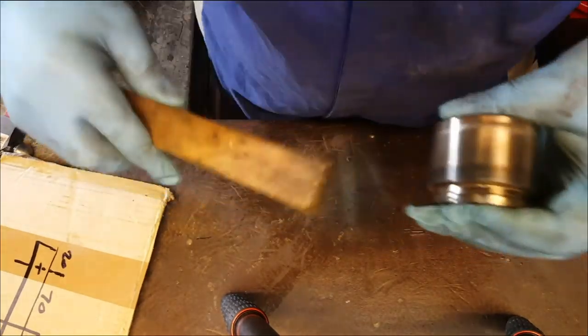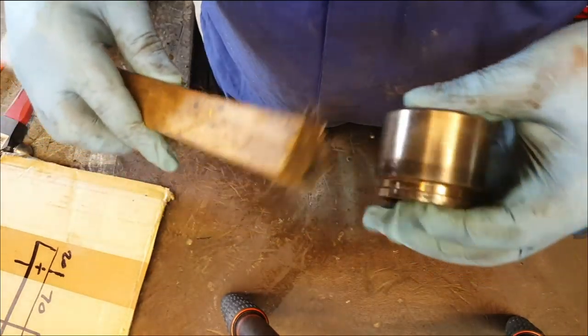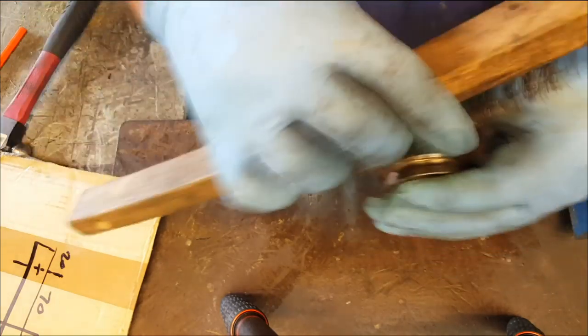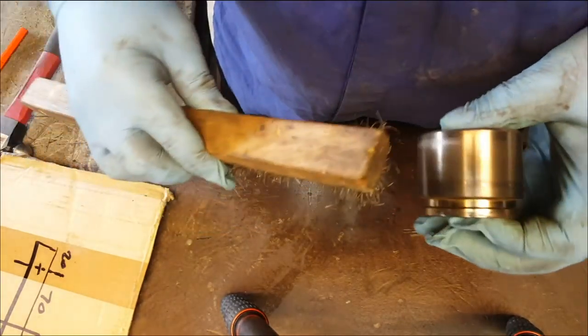Now, if this isn't enough, which it probably won't be, but it gets rid of a lot of the contaminants so you don't block up your sandpaper quite so quickly, I'll grab a bit of wet and dry, which is really, really fine, that you tend to use for bodywork repairs and stuff, for flatting off paint. And we'll give it a quick once over with that and see if that's going to smooth the whole thing out. Now, this is a process that I've covered before on a Nissan Patrol, front calipers, and a Honda dirt bike, and the Yamaha Viking that we did with all the brakes on that as well. So a lot of this video is common, but this is specific to the Ford Courier, especially the rear brake side of it.